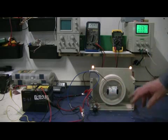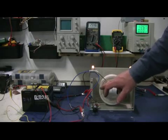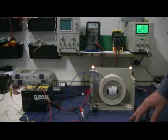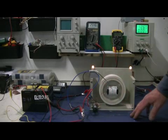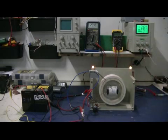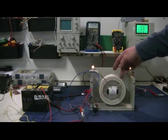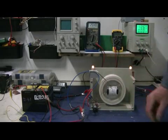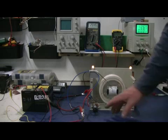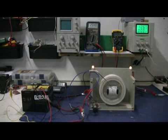And it'll run really slow — the benefit is that with the magnets on both sides of the coil, the trigger coil fires up at a very slow speed to fire up the transistor. So that's another advantage of it. You really notice a squeak in the coil now with the magnets on both sides of it.